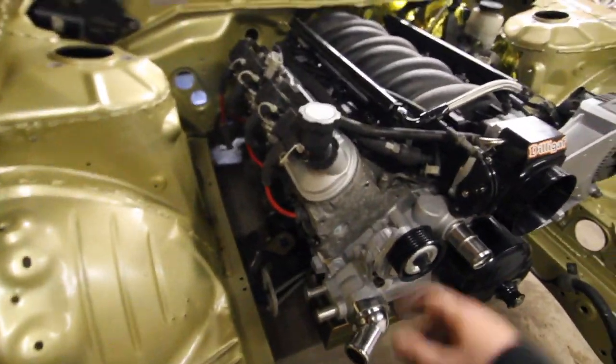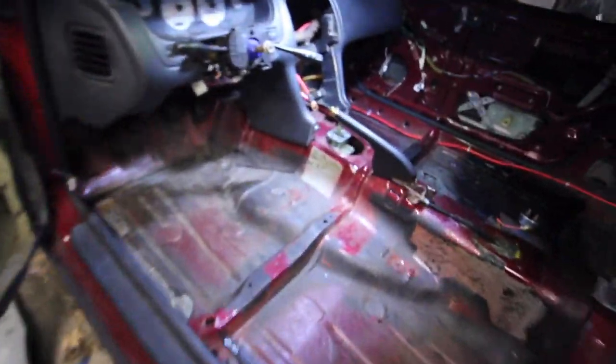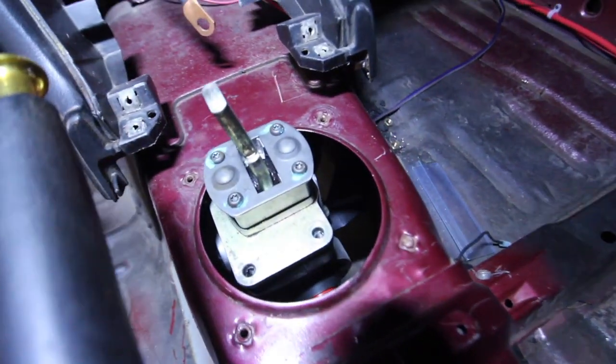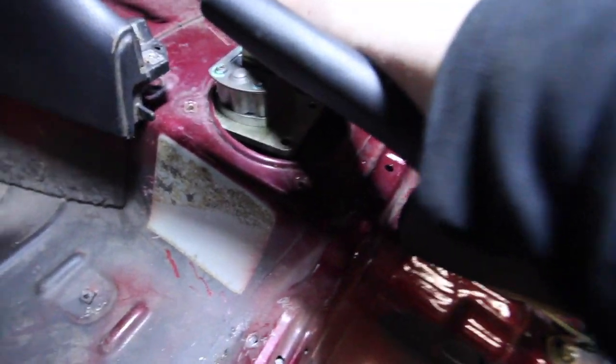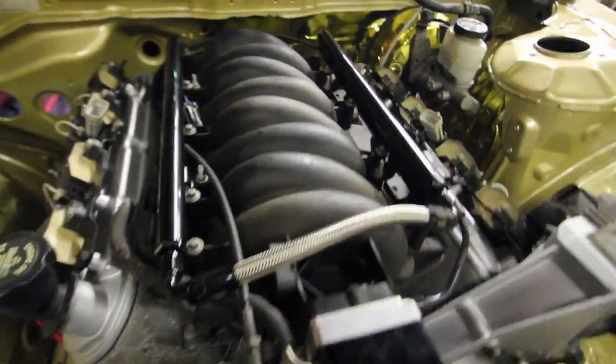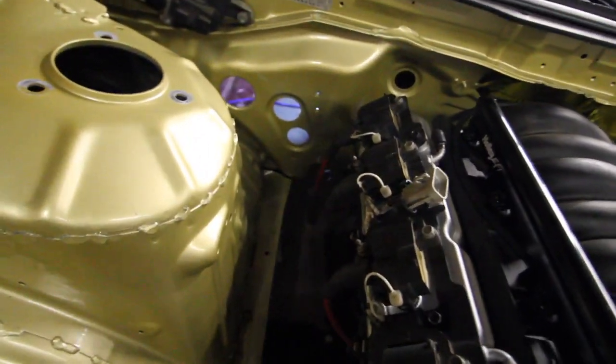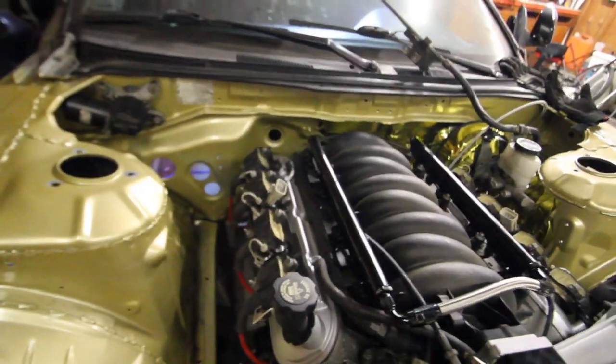That's what it looks like — all the mounts on the sides are fully bolted in and the trans mount is fully on. Let me show you what the trans looks like in the tunnel — it's a bit crooked but that's where it's at. I just put the shifter on there so it's not open. Next I'm going to finish up the fuel system — get the fuel rails connected. This piece here and the piece back here will be blocked off, and over here it'll connect to my fuel filter slash fuel pressure regulator mounted right there, then the fuel line kit goes all the way back to the tank.